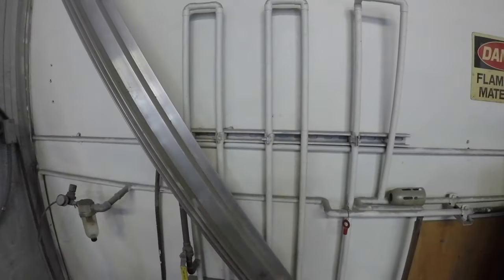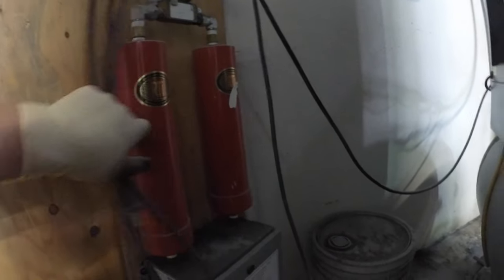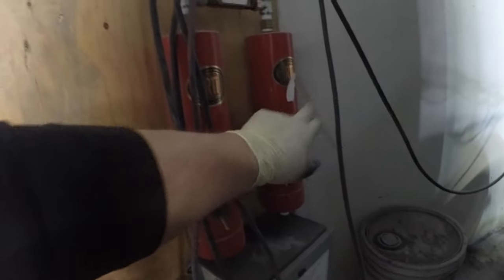So we got our air coming in here from the compressor. It's going up and down through these lines, going to these filters right here. We got two pre-filters and then this is our desiccant. There's two tanks — it switches from one tank to another. Once one tank is wet, while that one's drying it works off the other one, and then while that one is drying it works off the first. So it goes back and forth and there's a command center right here that regulates that. This system is a lifesaver. My paint jobs wouldn't be what they are without RTI on my side. I'm not sponsored by them, unfortunately, so I don't get any free stuff, but we've had the system for about five years now and it's a complete game changer.